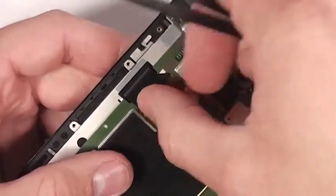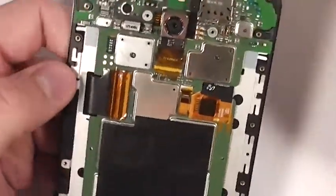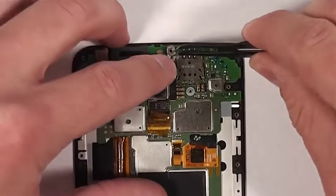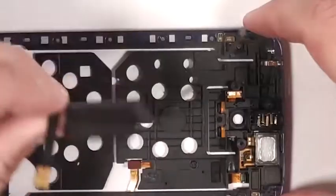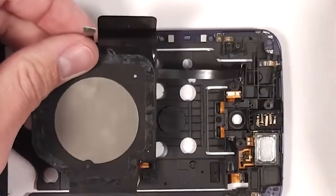And then get the yellow tape and put it over the top of all of these ribbon cable connections that you've undone. Pretty simple. Get that one screw and the little metal drop bracket back into place at the top of the motherboard. And the motherboard has two little latches as well, so make sure that it's tucked down into that frame.